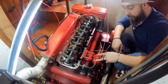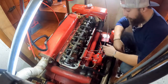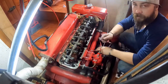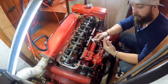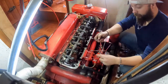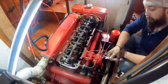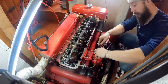So we've got these two nuts — or bolts — on top of the fuel filter. These are bleeders. If anyone's dealt with a mechanical injected diesel, once air gets in here you have to bleed it all the way out to get it to fire off again. They can be kind of a bear. Once they're going, as long as air doesn't re-enter the system, they'll pretty much run indefinitely. This is one of the bleeders that when I went to tighten it, you can see it just spins — so that's totally sucking in air.